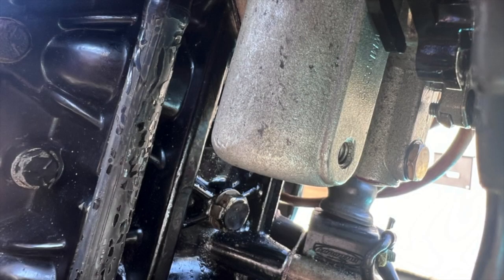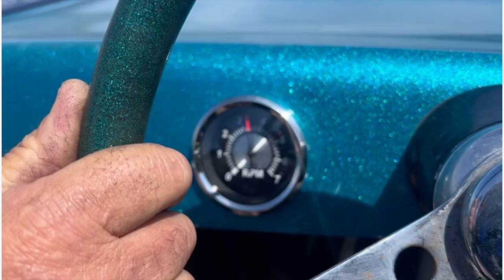Since they all look the same, and there are several available, I took a photo of the middle carburetor, and it was a WMK22. For some unexplained reason, we never realized that the bottom carb was a WMK14. Our Hail Mary replacement of the lower carb with the WMK22-3 from a 150 worked. The engine now has ideal mid-range and full throttle performance.